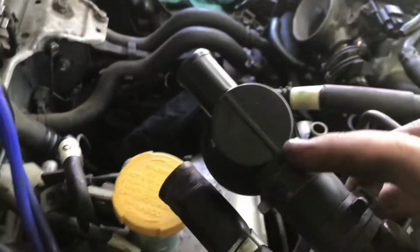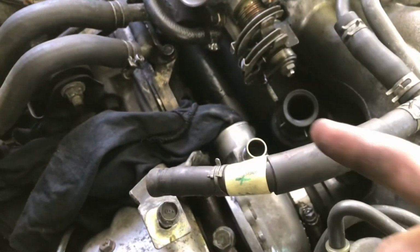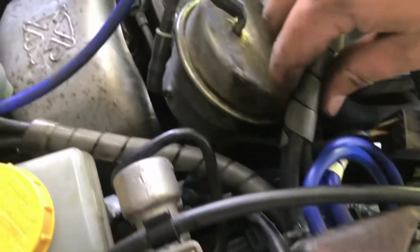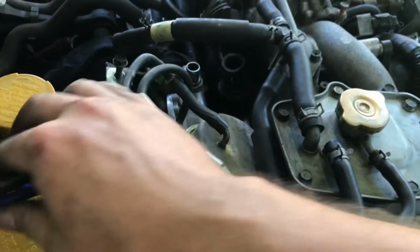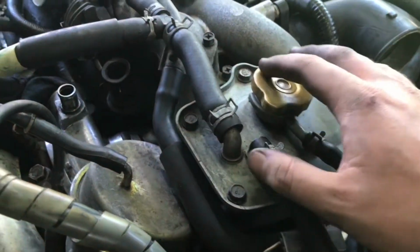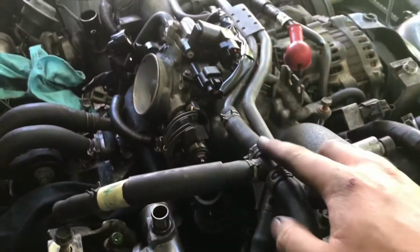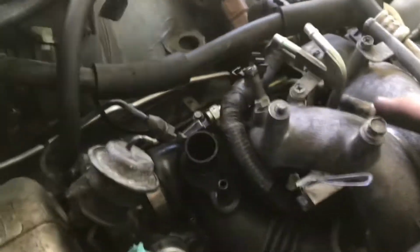This one goes into the duct pipe, which is down there on the right, and then that one goes into the turbo. That's on the first assortment of this one. There's lots of vacuum hose here. And then the coolant line, so coolant reservoir here, runs down, tees off into this turbo, and then this goes directly underneath there for the other turbo. So that's the coolant lines done.